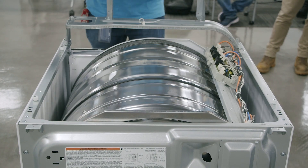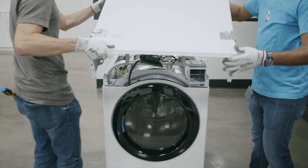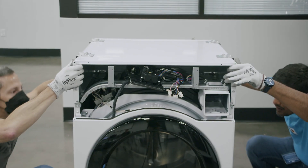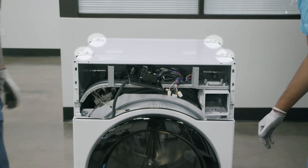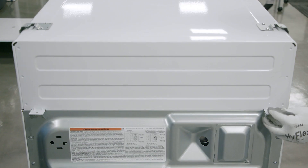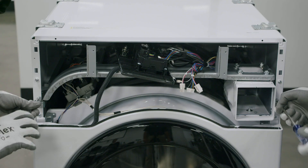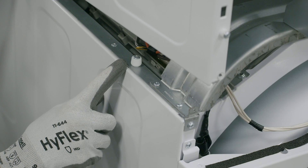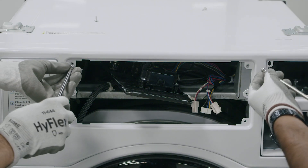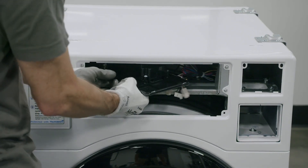Step 2. Next, we need to swap the two top panels. For the bottom dryer, take the top panel from the top dryer and install it onto the bottom dryer. This will be the top panel with the four stacking brackets installed in each corner. Install on the bottom dryer and drive all four screws that hold this top panel in place. Ensure the four key slots in the top cover's bottom side align with the four posts on the top of the cabinet. Remount the control panel frame, fasten the four screws, then reinstall the control panel and lock into place.